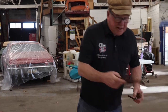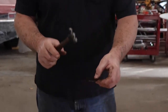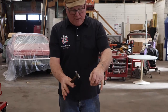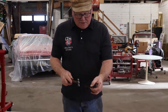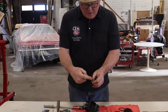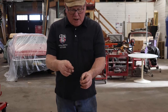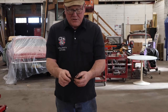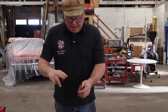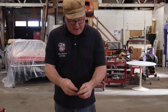Then use your smallest hammer — your gasket hammer — and just tunk, tunk, tunk. Keep watching it to make sure it's not going in on an angle, because it'll bend. The set I just used turned out to be shorter than the original, and they bottomed out when I tapped too hard and pushed the dust seal out. So I had to ease it back up again with a screwdriver, just ease it up a little bit so I could get the dust seal back in there.